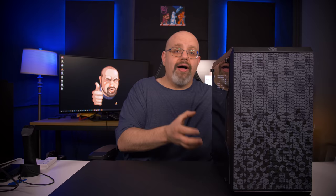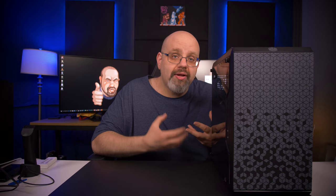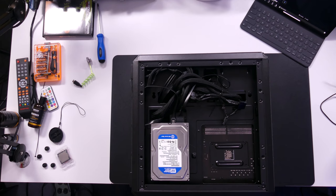So, storage — this is where I cut back a little bit. I see other $500 builds on YouTube that don't even have a secondary storage drive, so I feel like I'm being generous here. This has a Western Digital 500 gigabyte 7200 RPM storage drive — a regular plain Jane mechanical drive. You could still put some games on there, and it's better than trying to cram a game onto a 240 gigabyte SSD, because there are games out there that are 130 to 150 gigabytes. I went light on the storage to add more performance to this computer.